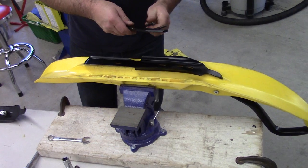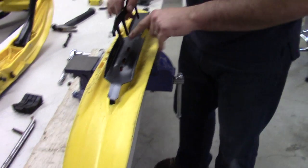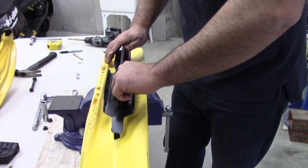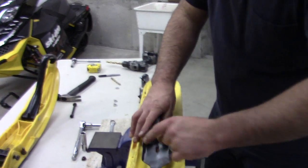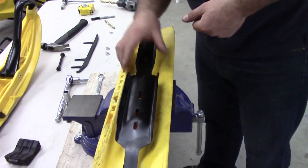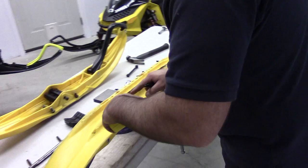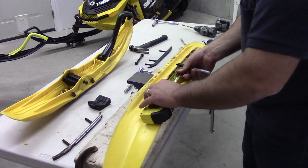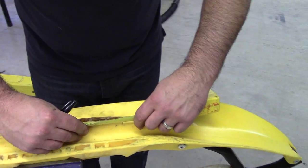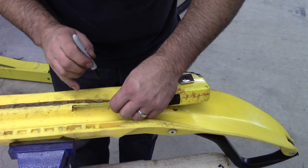You're going to take your Snow Tracker carbide. You'll see that it's going to require two holes in the front, so we're actually going to have to drill one more hole through. The next hole that we're going to drill is going to be 2½ inches forward again from the center of your front hole. We'll measure our 2½ inches and put a little mark there as well.